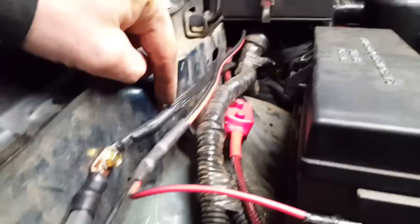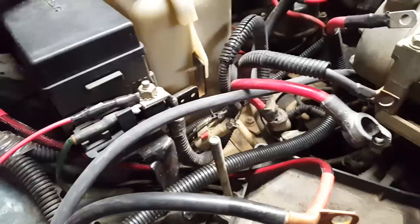The last ground cable is a fender to battery. The battery's out, obviously. I was able to bolt it right there — I think it's going to be plenty long enough to reach the battery. This used to ground my Rough Country light control box that I don't have anything hooked up to yet. I had that grounding just to the fender by itself, which is definitely adequate as long as we have a good ground cable going to the fender. But now it's actually going to essentially be the same as connecting from the battery to the box itself, because I have these overlapped and sharing the same bolt.